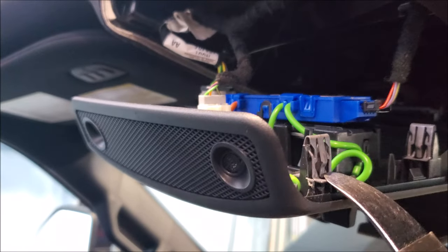And it goes for any panel really. Here is where all the clips are — start back here. You want to get up inside, right onto the clip, and pry it. Go to the next side — releasing one should cause the other to come out at the same time.